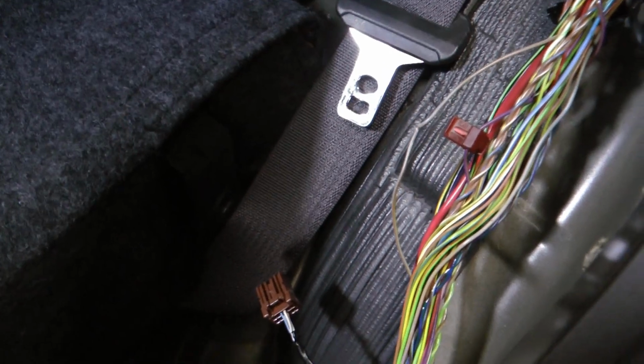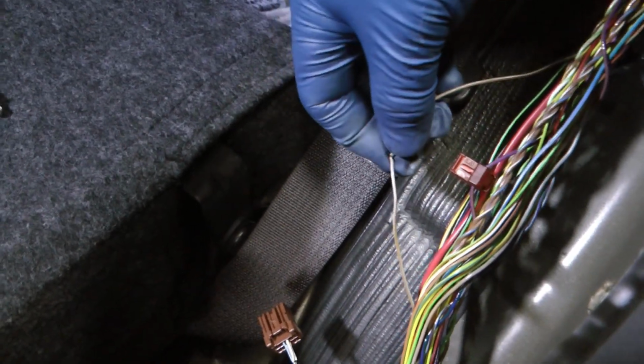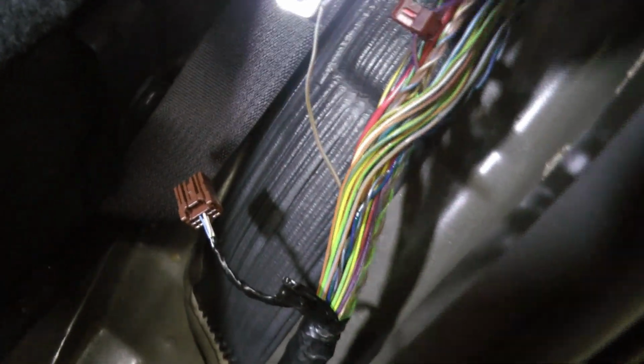So it appears that they cut this wire, and also the wire on that side, they cut it somewhere between here and the brake pedal. Let's get back to why. Why, if you're a downfitter, do you cut the brake light wire instead of just hooking up something that bypasses the brake switch? That's what you would normally do to correctly do. If you're wanting to wire it so that the police can turn the brake lights off and roll in dark, which is a normal thing.